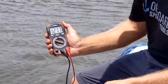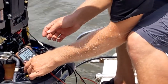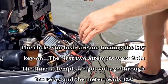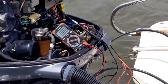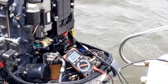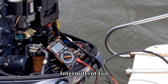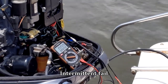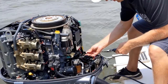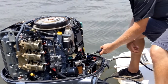You can see right there — we have 12.7 volts. Can you see these numbers okay? We should have nothing on this side, and we have nothing right now. Next thing I'm going to do is pump the key and see if we get any voltage. With a failing relay, you'll get no voltage or very minimum voltage. We've got two fails and one ignition. So now we're testing the start circuit — this is basically going directly from 12-volt hot voltage to our starter. I'm going to touch this on the uphill side of our relay. No hesitation — the kill switch is out.